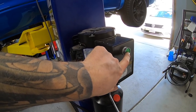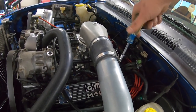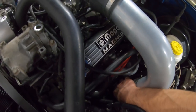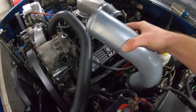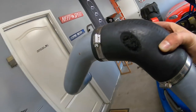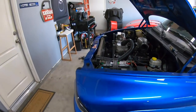I'm going to disconnect this from here for now. There's actually a burn mark on this pipe — not from me, from some previous owner — and it almost penetrated right through, but it held boost at 10 pounds, so I'll take that. There's the burn mark from the pipe touching whatever header setup they had previously. One more pipe is off.